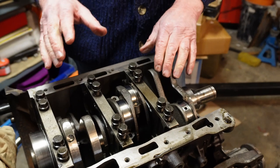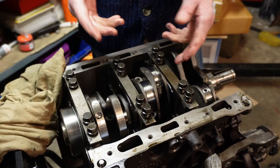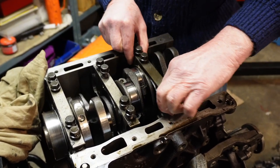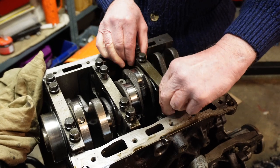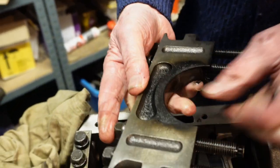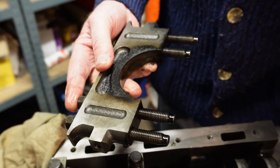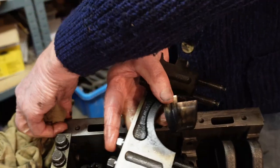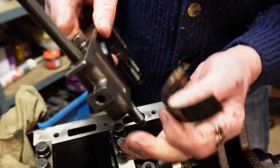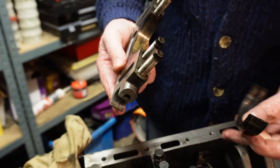These cranks do snap — it's quite rare on the Jaguar, but on the Land Rover it's not so rare. Straight away you can see the burn marks on that — these shells have. Yes, I can see this shell should be on the bottom, placed on the block where the oil feed is, and this is on the top — that shell is very worn. It's also worn the cap as well. So I'd imagine the base of the block is worn too. That's terrible — that's got red hot. What's happened is it's just spun, it's just stayed on the bearing and spun round. It should stay in the cap. It's very burnt on that side — that is definitely the problem.